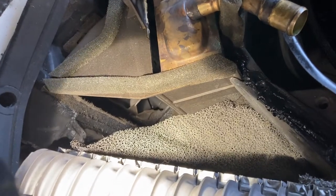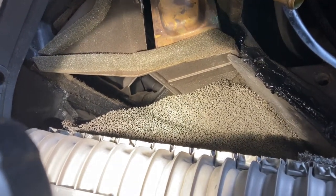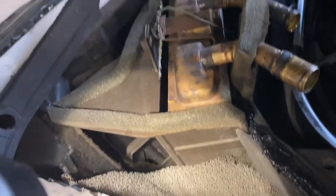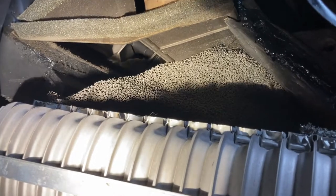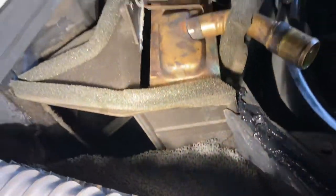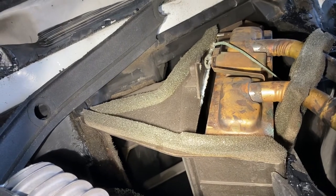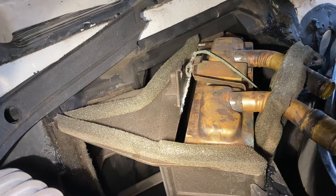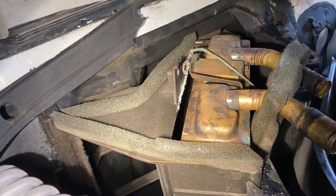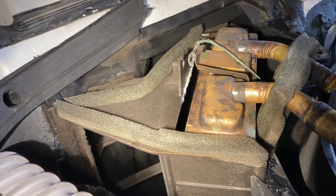But the point of the remark being that, look, we want to clean this out just like a refrigerator coil. And though we're going to replace the heater core, let's pay close attention to that evaporator core and keep all these fillers, that little foam filler. You can get that at Meijer or at a hardware store. And seal off these two enemies, no pun intended, so they don't interact with one another.